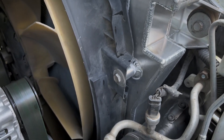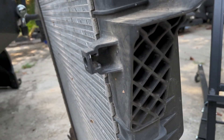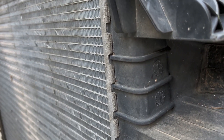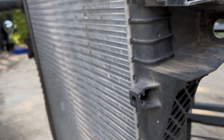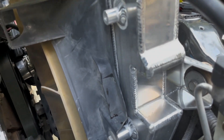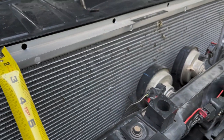The increased cooling capacity comes with it being thicker. Where it beats out the OEM one is that the OEM has dead space — the end tanks are crimped-on plastic, so there are areas where that radiator can fail at the seams. On the Mishimoto, the entire thing is welded — it's a solid radiator.